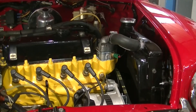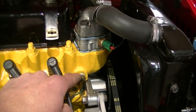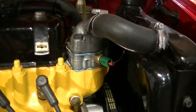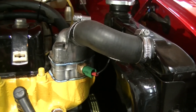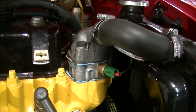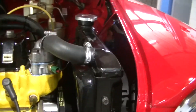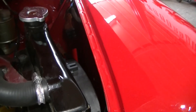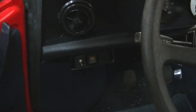One of the things I had to figure out was where to put the temperature sensor. I had a few options — I could have plumbed it in at the water temperature gauge sensor on the dashboard, or drilled a hole in the thermostat housing. Instead, I used a sandwich plate from a later type Mini so it bolted right on; I only had to drill a hole for the sensor. Because the thermostat housing now sits higher, I had to make a custom bracket so it fits to the radiator, making it a little bit shorter so the radiator leans in more towards the engine, giving more room to the fan. On the inside I also fitted a switch so I can manually override the temperature sensor just in case necessary.